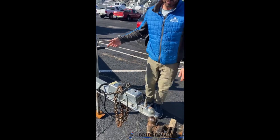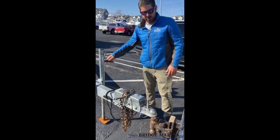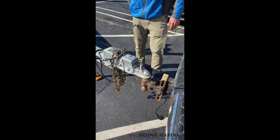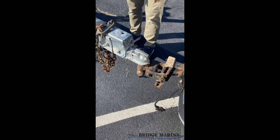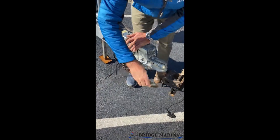I want to get myself centered right underneath the coupler. I'm going to bring it on down there. If I'm off a little, it doesn't matter too much, because usually I can nudge or bring that thing right on. I'm seeing it's fitting really tight between that ball and the socket, and latch it over. I'm not going to put it all the way down yet, because I'm going to test it a minute, but I want to make sure I connect everything and it's secure.